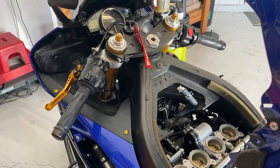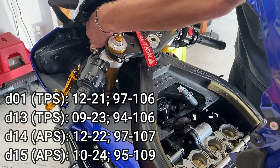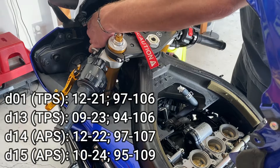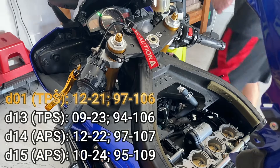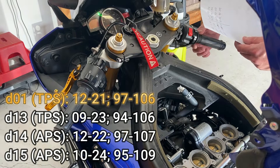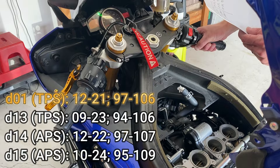I'm going to put the acceptable values on screen again, just similar to how I did on the last video. Let's enter diagnostic mode by holding down both the select and reset buttons at the same time, turn the key — should get the HI, then it will switch to diag — release the buttons, press both and hold again. We are now in diagnostic mode one. As I turn the throttle, it should start from 12 to 21 — we're currently reading 16. And as I turn, you can see the valves move. My max value is showing 99, and it should be between 97 and 106, so that is acceptable — it's bouncing between 99 and 100.